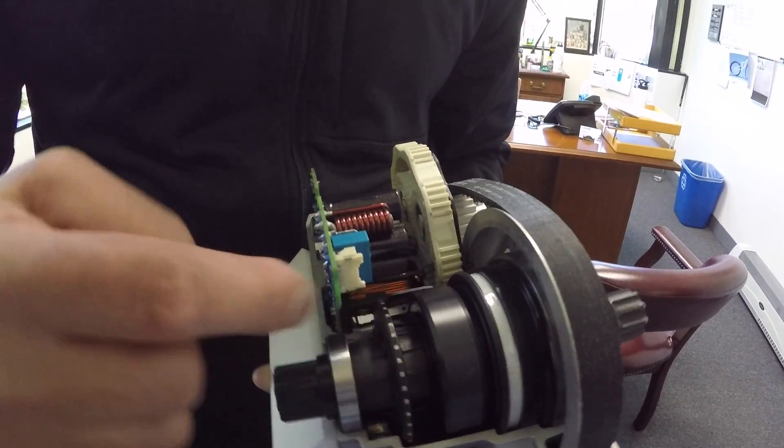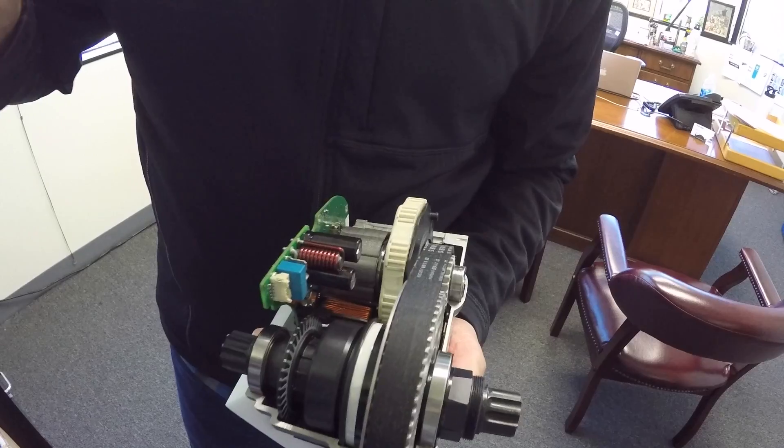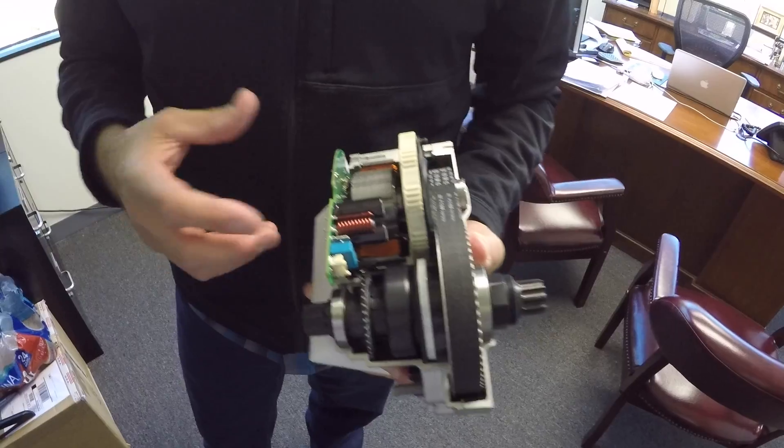All the sensor technology — you can see here's a rotational sensor, and there are torque sensors built into this mechanism as well that can tell how hard you're pushing on the pedals. And then this printed circuit board assembly is a microprocessor that takes all that information and computes it a thousand times a second, and provides power to the crank. On the best systems, using torque and cadence, it's in perfect harmony with your own human power input, so it's very, very intuitive.